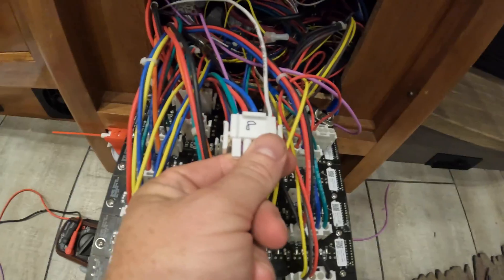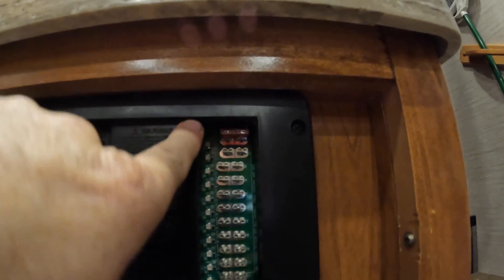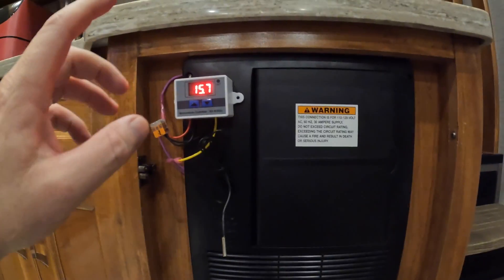Alright, I'm back. I left the pigtail unplugged and plugged directly into the end of it. I didn't de-terminal it because my de-terminal tools aren't here, so I just electrical taped it. You could cut it and use a butt connector to reconnect once everything's back together — trying to minimize splices. I did put a fuse in line for my positive.